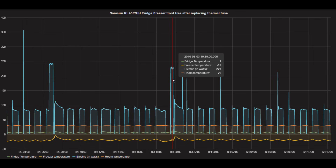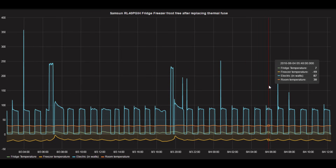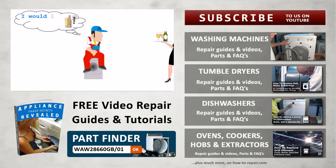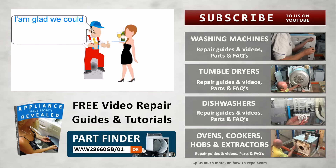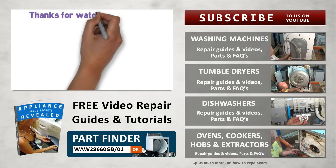You can see that our temperature probe, which measures the air temperature in the freezer (not the mass of food), rises to about minus 6 degrees — about 10 degrees more than on our first graph. This doesn't mean the overall freezer temperature rises to this level because the mass of food will hold the temperature, but for a 10 to 15 minute period the air temperature rises to minus 6 and the evaporator plate gets warm, melts the ice off, and it drains through the drain hole onto the collection tray on top of the compressor and evaporates away. This keeps the airflow in the freezer working perfectly, allowing air to be blown to the fridge and the fridge freezer to maintain its temperatures correctly. I hope you found this video helpful — please remember to shop at How To Repair, as that's what keeps us going and able to make these videos.